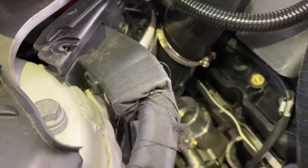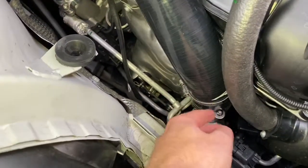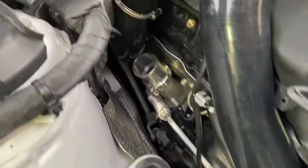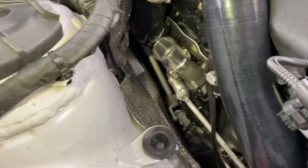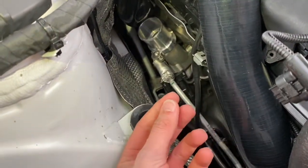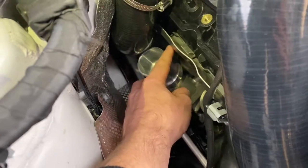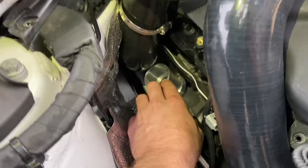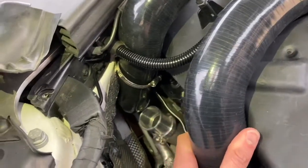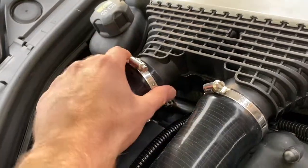There are two — one in the back and one in the front. As you can see, we have already fitted our AP charge pipes onto them. We recommend using a lubricant on the insides of the charge pipes themselves and on the outer ring of our aluminium adapters. This will assist you to slide the charge pipes over them and onto the charge cooler itself on the top here.